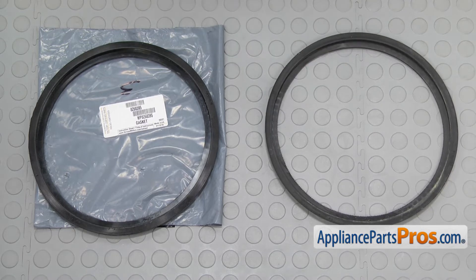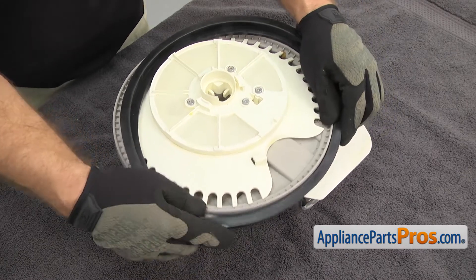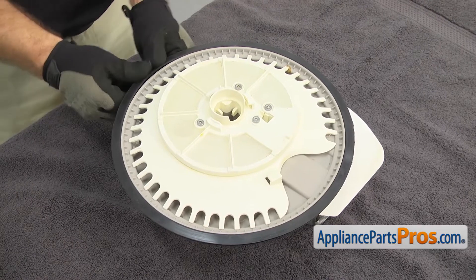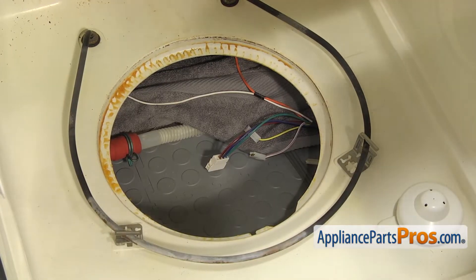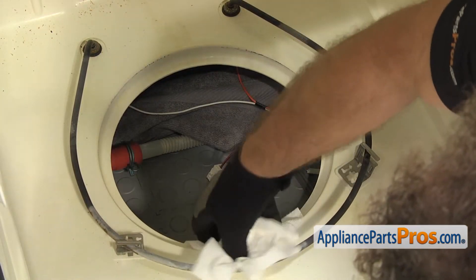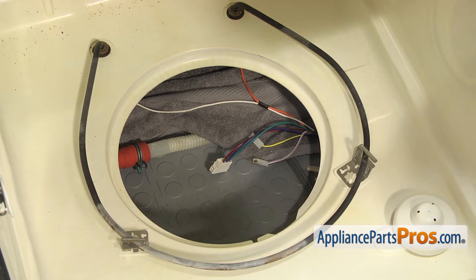Here's the old sump gasket next to the new one. If you already have one of these great, if not, you can get it at AppliancePartsPros.com. To put the new sump gasket on, we're just going to get the lip underneath the sump and stretch it around. Once you have it in place, we can put the sump assembly back into the dishwasher. Before we put the sump back in the dishwasher, you want to make sure you clean this area up so when you push it down in there, you get a good seal. Once you have the lip of the tub cleaned up, you want to leave that wet and also get the new sump gasket wet — that'll make it easier to slide the sump assembly down into the bottom of the tub.